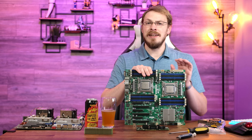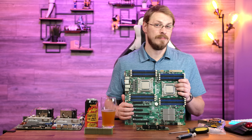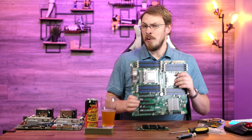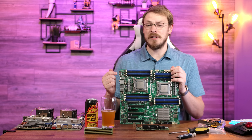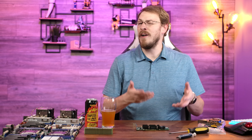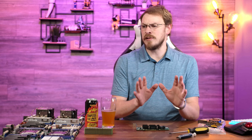First off, I'm moving to the SuperMicro X9 DAI, which is again still a dual 2011 motherboard, but has a full six PCI Express expansion slots, all of them being X8 or higher. A couple notes: the X9 DAI is actually a workstation board and not a server board, so I am giving up a couple features with that. For one, I don't have IPMI on this motherboard. And number two, there's no video output on here, meaning if I want video output out of the server, I'm going to have to plug in a video card. However, I am currently working on a solution to share a graphics card both with the host and with a virtual machine inside of it — so make sure you're subscribed if you don't want to miss that one. The CPUs are the Xeon E5-4627 V2, which are 3.3 gigahertz, eight core, eight threaded CPUs with a turbo of four gigahertz — the fastest single-threaded CPUs available for this platform, excluding the enthusiast chips and overclocking. So without any further ado, I'm going to go ahead and take a backup of my TrueNAS configuration, power down the server, and bring it in here so I can finally get the motherboard swapped out.